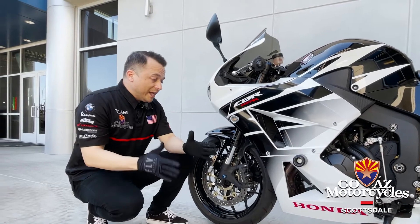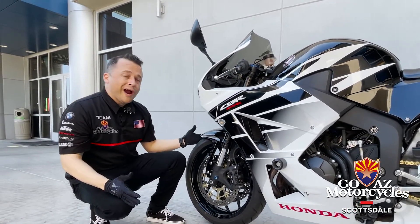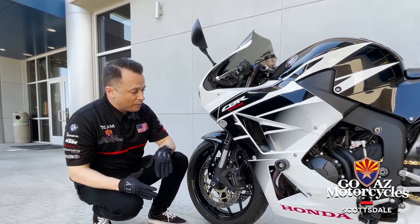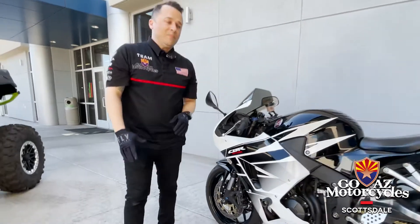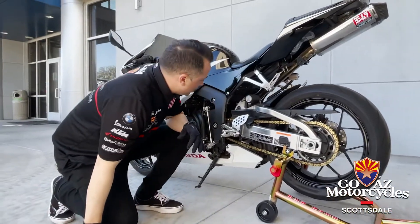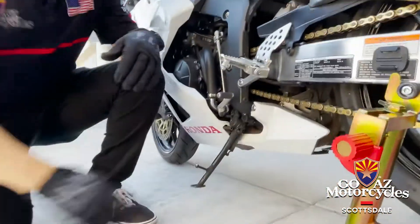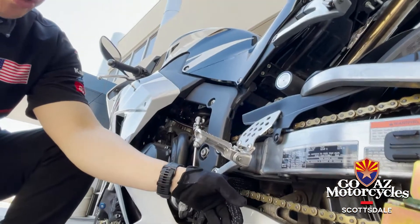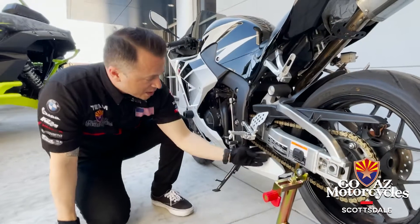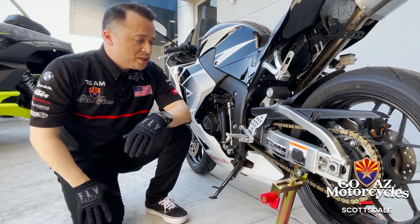Good fork damping is also going to make sure our tire is hanging on to the pavement the way it's meant to. We're all good up here on the front fork. Swinging back to take a peek at the rear shock — these can sometimes be buried, so you want to get down in there. We can see the bottom of it; it looks like it's got some adjustment on it. We want to make sure the adjustment is appropriate to our weight, height, and speed, and that there's no moisture built up. This one looks good too.